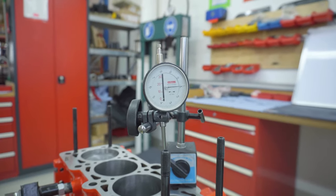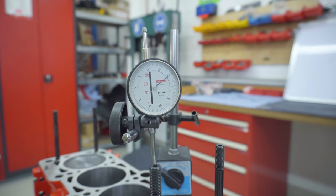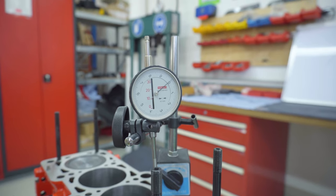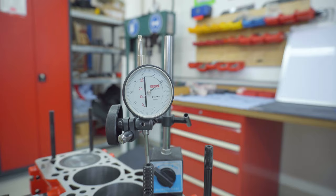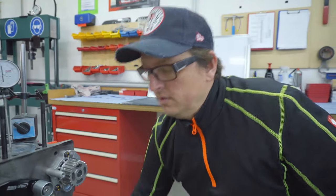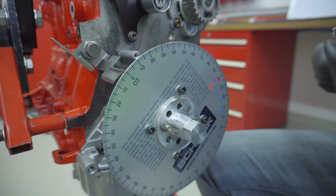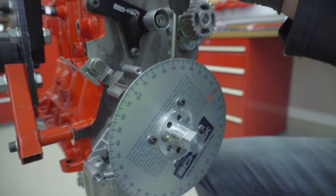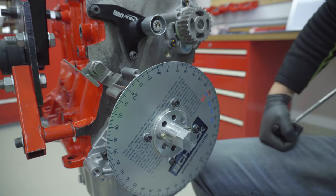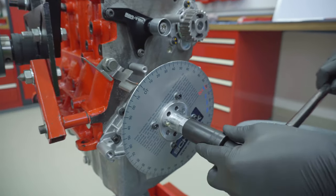We need to check which direction to go first — we go up to TDC on the gauge. You can see slowly, slowly, then it stops, and now I can still turn and turning, turning, turning, and then it starts to move again. So basically I go back a bit — I think it's more or less at this position, just a kind of guessing or starting point. Now I can turn the plate. I'll start at this point for TDC and tighten the small bolt a bit.